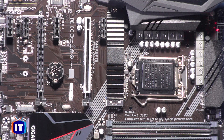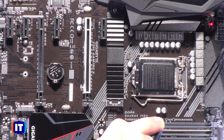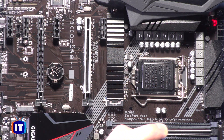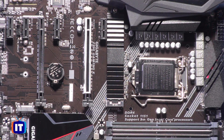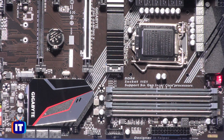Some other things we see on the motherboard: up in the upper right-hand corner, that is actually our 12-volt CPU connector. Just below that, there are four pins — those four pins are for one of the system fans. If you have multiple system fans, that's where you can make one of the connections. And just beyond this little heat sink, there's another four-pin connection — that's actually the CPU fan.